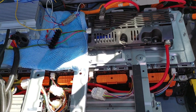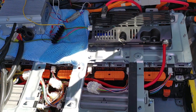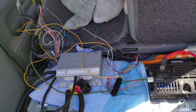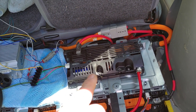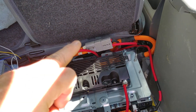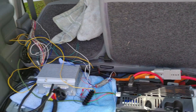We have two additional modules here on the back side, and they're connected with these orange bus bars. All the messy cabling there is the battery management system, which connects each single cell to a central computer sitting up there, which does the load balancing — especially while charging — for the lithium-ion charging. Here we have the main contactors and the pre-charge circuit, so the power comes in from this side, does the pre-charging, then the main contactor goes on. The cables will be changed to orange cables for legal compliance.